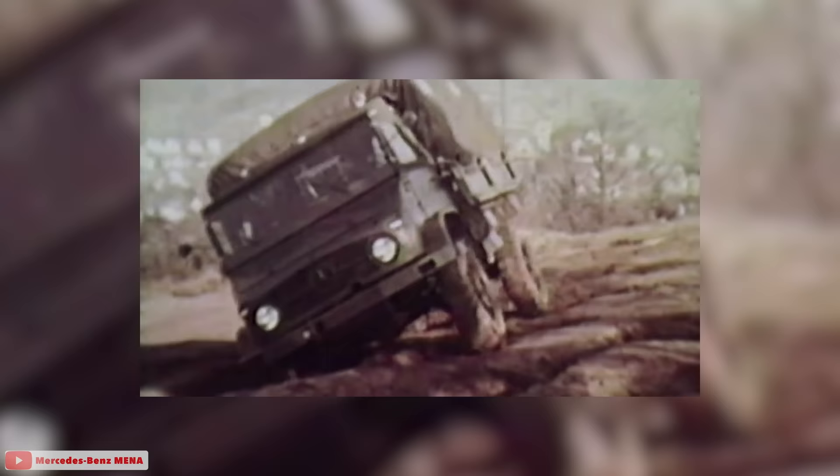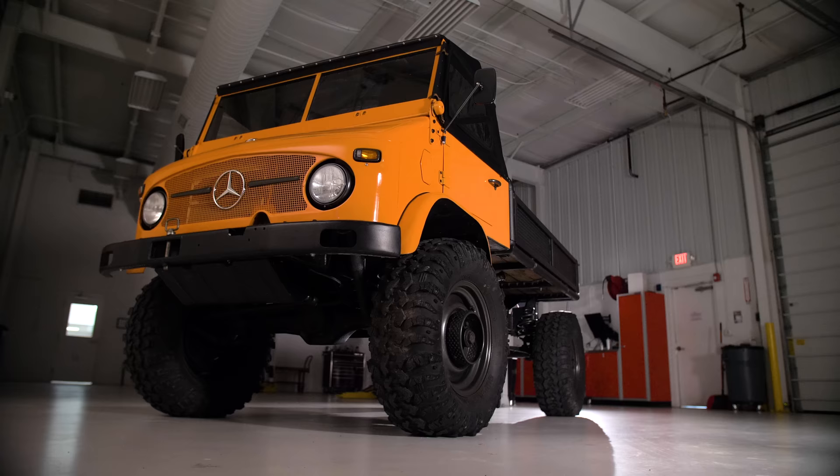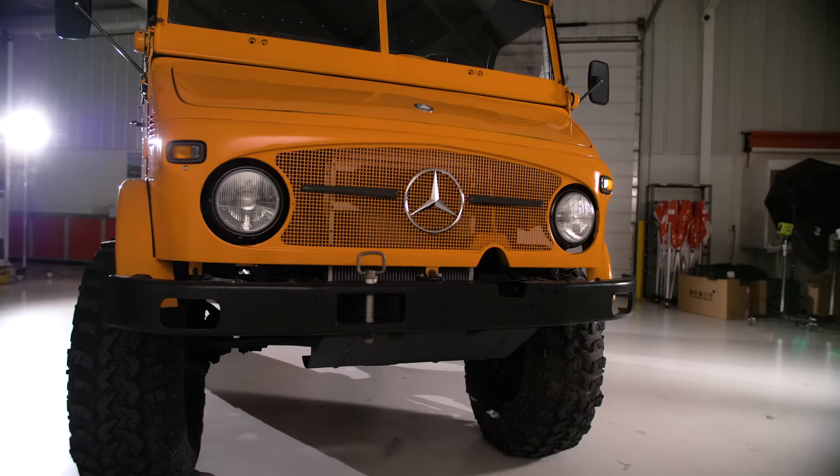The engine and trans are mounted together, mounted on rubber bushings at the back and then a pivot kind of leaf spring shackle at the front. They articulate from frame twist, so everything is riveted, everything is allowed to flex, and because of that nothing is solid mounted. That's why the engine stays stationary while the frame twists around it — same with the cab.